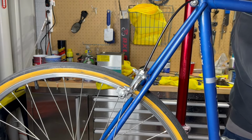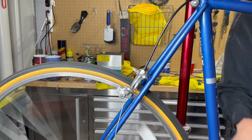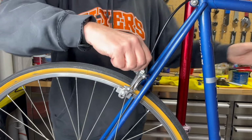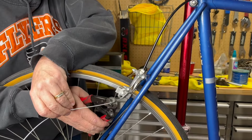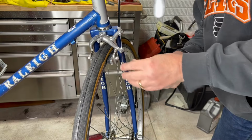The frame cleaned up nicely and has just the right amount of patina. I was a bit worried about the chain line, but in the end, I believe it's close enough that it won't make that much of a difference, and the bike rides nicely. I installed a nice, easy, and relaxed gear ratio, and the horizontal dropouts made tensioning the chain a breeze.